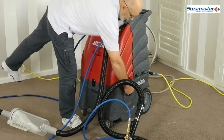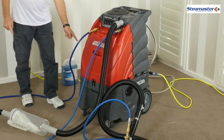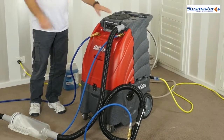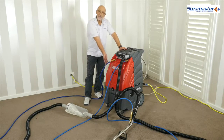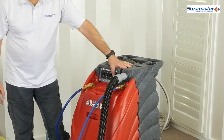A couple of little things to watch here. There's a little vent on that side and another one on this side as well. They're there to keep the airflow into the motor to keep it cool. These motors are very powerful and if you've got a curtain blowing up against that and blocking the airflow, it can overheat the motor. So let's switch on.